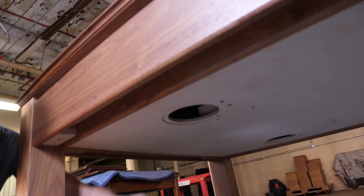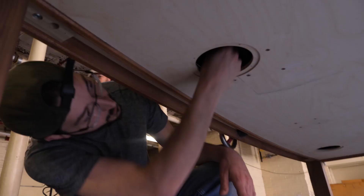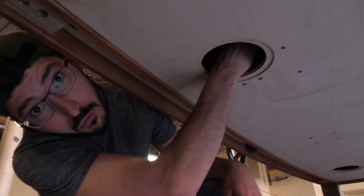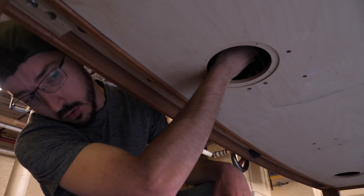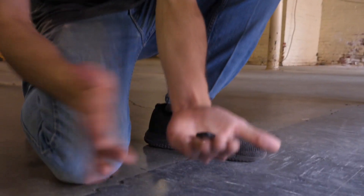It's just four screws. I went and unscrewed them with a Phillips head driver. At this point we're going to reach into the access hole, and there is a thumb screw — very easy to see. It's a black plastic thumb screw. I'm going to remove it just like that. Keep the washer and thumb screw.